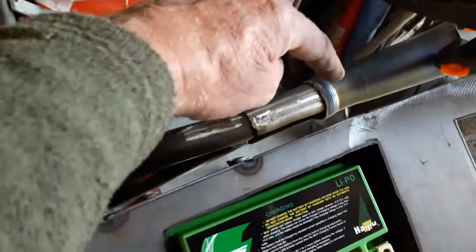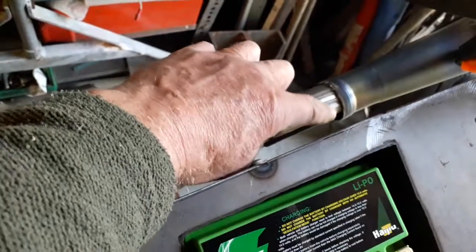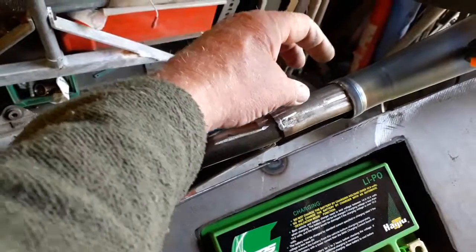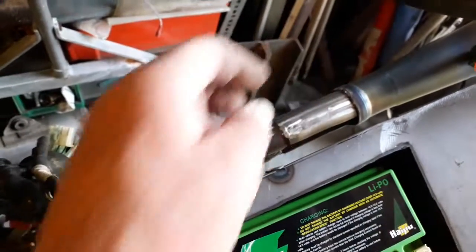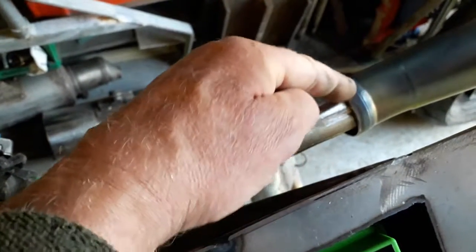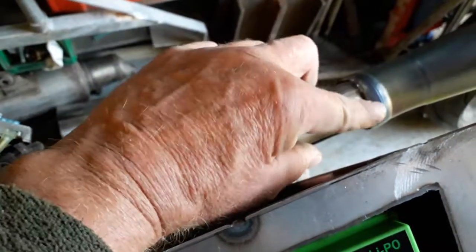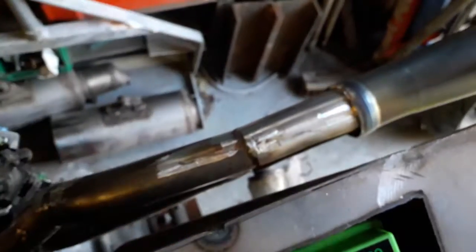There's a small issue with welding the exhaust on — it's titanium to stainless. Now you can weld titanium to stainless, but you need a massive shroud on your TIG torch so that as you're welding, the weld is cooled by the gas to stop it cracking. Which I haven't got — you have to make one. So I'm going to just clean these broken welds up, then I'm going to slot this. I've bought a clamp to go around there, and I'm going to use some exhaust putty and bandage inside there as a gasket, very similar to what's on the original exhaust. Then I'm going to clamp it and we'll see how we get on with that.